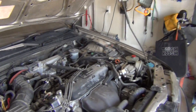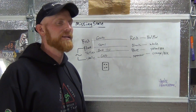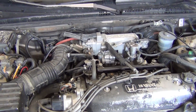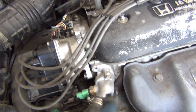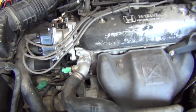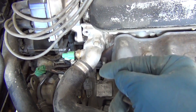Should we go drive it? Let's do it. We're patting each other on the back — awesome, great. And then all of a sudden it started to lope, going up and down again. Just about to put her down for a test drive and it starts doing this — this is what it was doing last night, so we couldn't set the timing. The way you set the timing is off the little marks right there. It jumps the mark every time it loads.